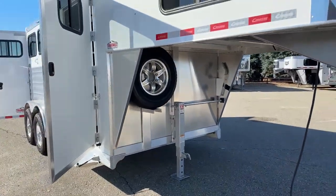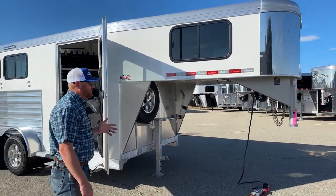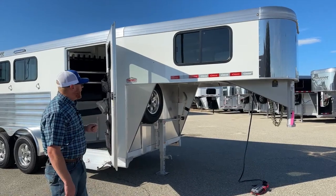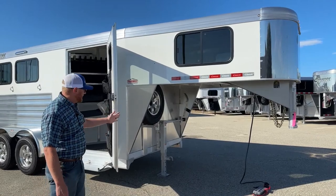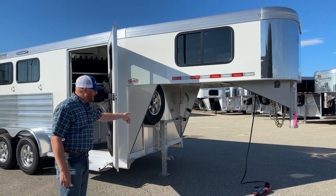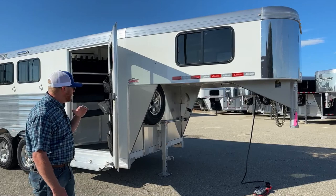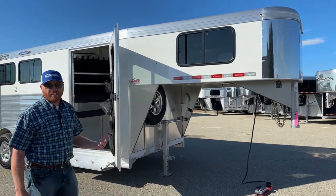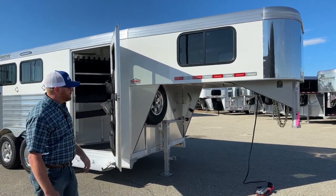The length of a Cimarron nose is 8 foot 2, which is a little bit longer than a lot of other trailers in today's market — many run a 7.5 to 8 foot nose. This gives us a little bit more storage up in the gooseneck area. The other benefit is, even if you're running a long box truck and drop your tailgate, you can still easily get in between the front end of the trailer and your tailgate and maneuver.